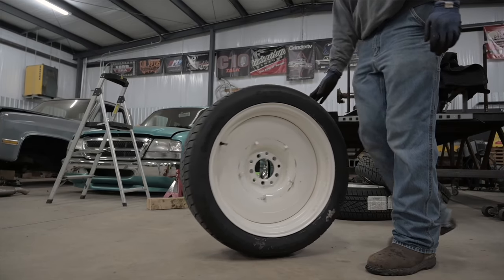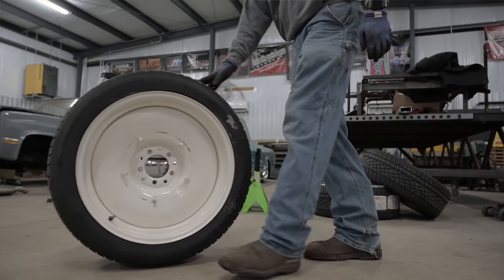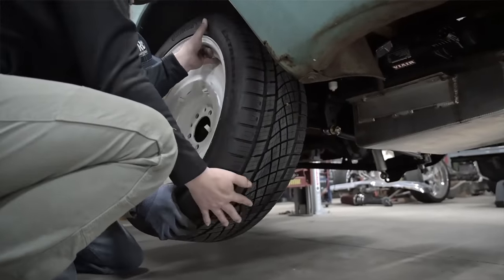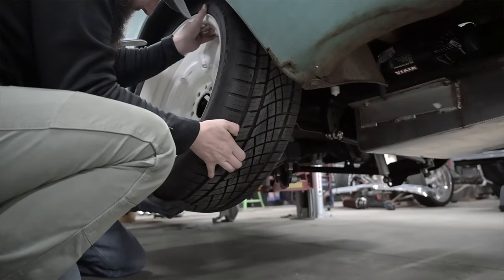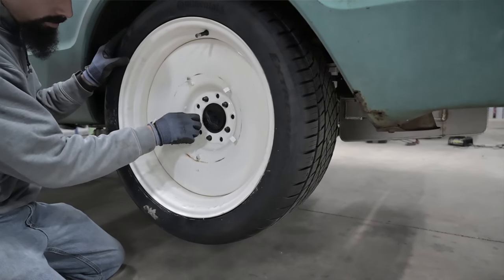And the reason we're doing that 275/40 in the rear is because I have a wider 71-72 factory rear end in the rear. And with a 4-inch backspace on the wheels, it makes it real tight up against the outer side, the bedside. So we got a little bit of fitment issues there. So I tried to go from a 285/40 to a 275/40, trying to correct that a little bit. But we're going to get these Continental tires and Detroit Steel wheels mounted up at least on the rear and keep plugging away.